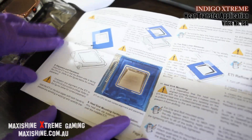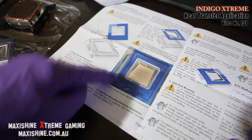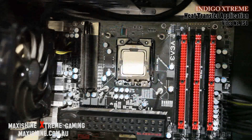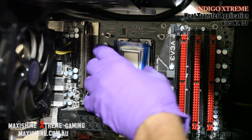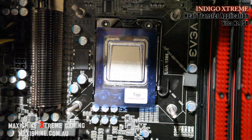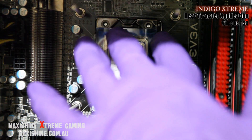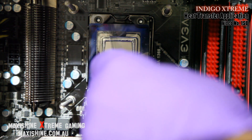I've got my gloves on. You can see there the instructions. You can see there the sticker, which goes onto the motherboard, showing the CPU socket. Basically all we want exposed is that horseshoe-looking thing sitting touching the CPU, which is what I'm going to go ahead and do now. I've applied it there — it gives you a little blue guideline that's the size of the CPU exactly, so you can just line that up. It says ensure that the blue part is touching the cover, and the CPU bracket closes over it.